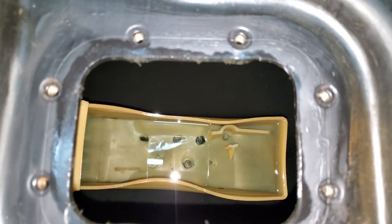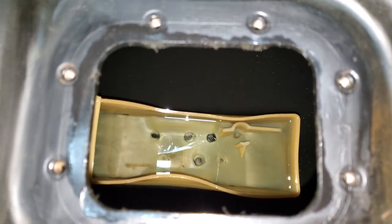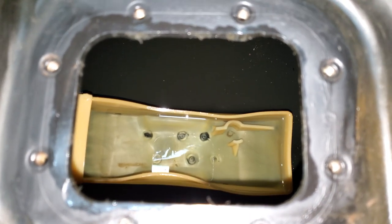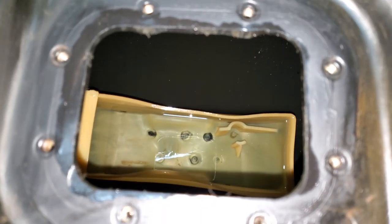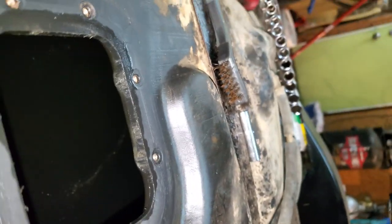If these trays get warped too much you will start having issues — possibly with your fuel gauge, maybe your float gets stuck on that box. I'm not having that issue so I'm just not going to touch it. But let's take a look inside.